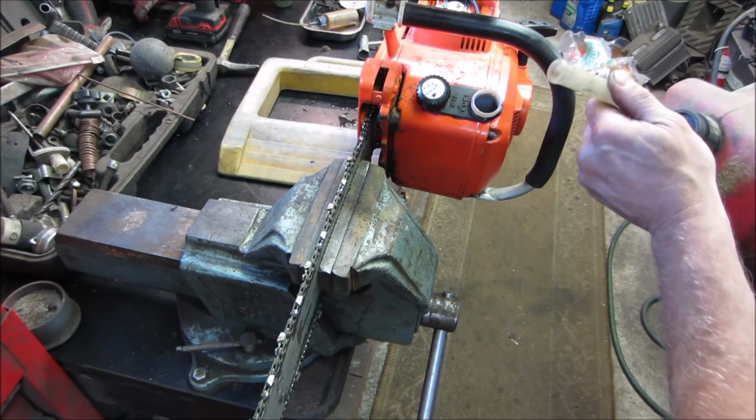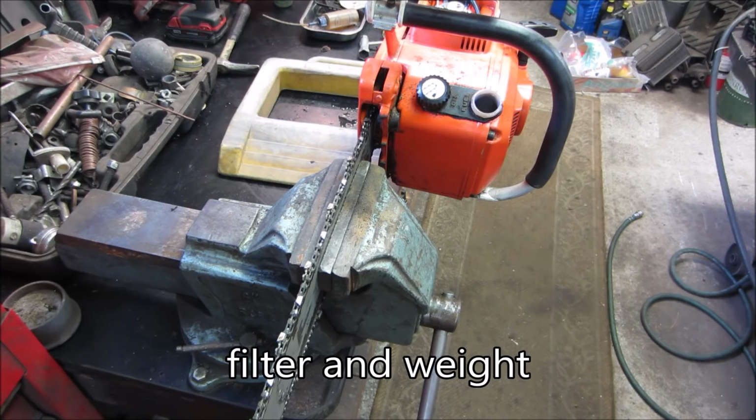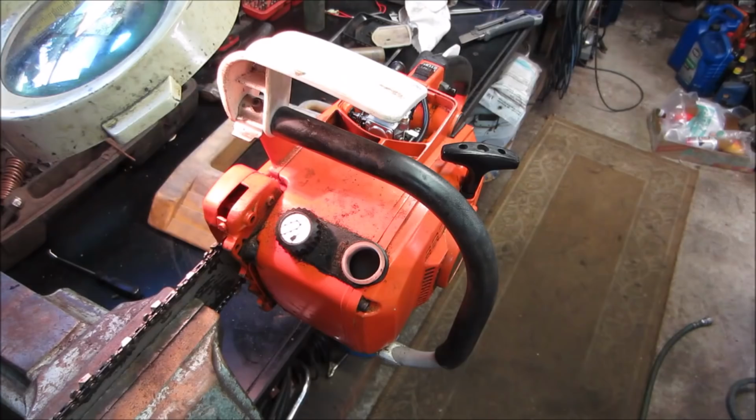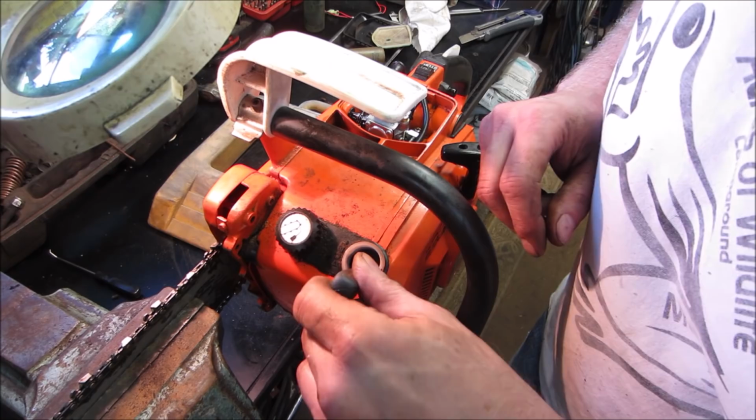It's half the tank. What I should have done now that I just thought about it is looked inside there. There'll be a fuel line going in that's kind of on a float, floating around, that has a tendency to break off. Now I think about it, of course. They have a tendency of splitting off the end, and then it just sucks air. Take a quick peek. I can see it.